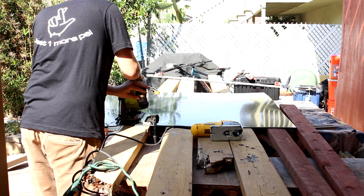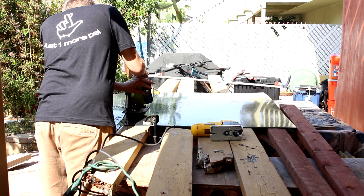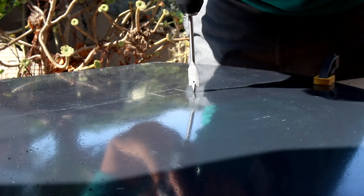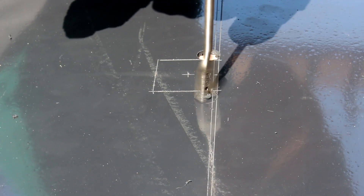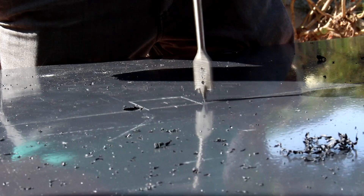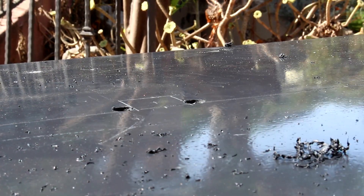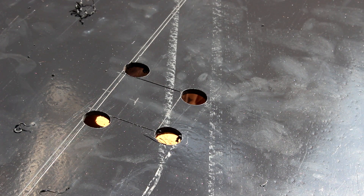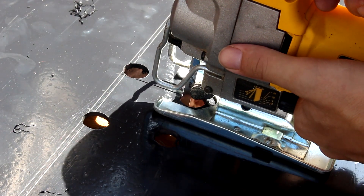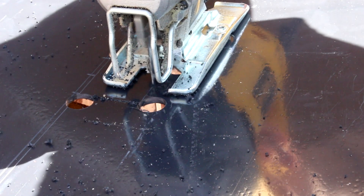The first thing we're going to do is cut out the main plate. If you're building it like this, factor in the length for the mounting tabs. Before we cut the bottom, we drilled three-quarter inch holes here — that's going to round the edges of the mounting tabs and not create stress risers. If you just cut at a 90 degree angle, those tabs are going to be way more prone to cracking, but a curved edge distributes the load better and it's not going to crack as easily. Then just jump in with the jigsaw and finish the cut.